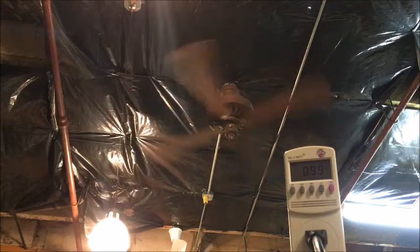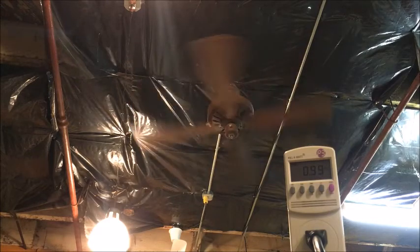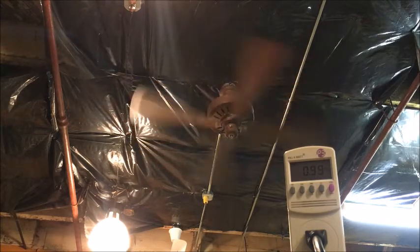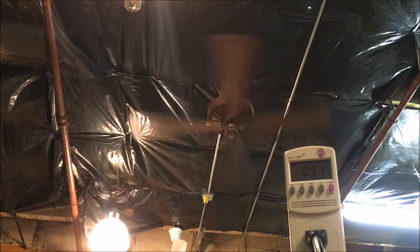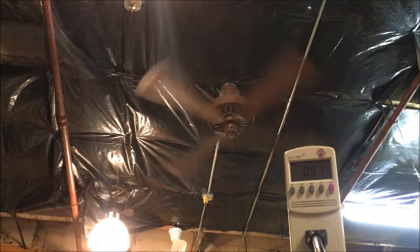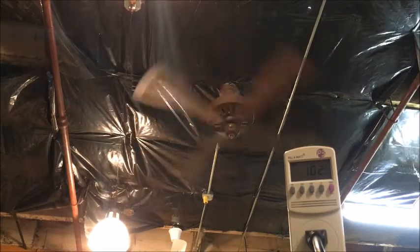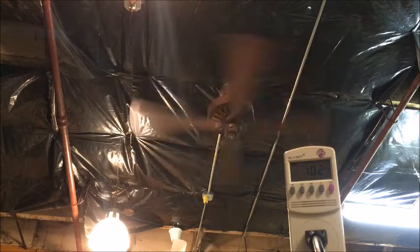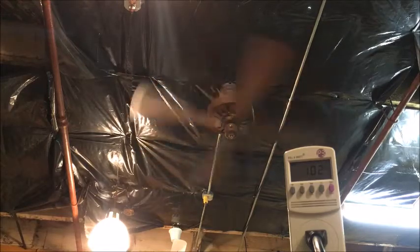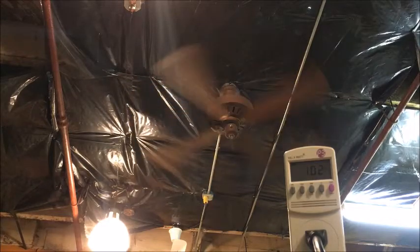Well, I'm already close to high with that. I don't know. Because I could use an 8-12-20, but this is kind of a useless speed. So I'm going to hit the high switch. And there's really no difference. That's the only thing. I thought an 8-12-20 would be great for this. But the only thing is, the 20 microfarads with the high medium is just too close to high.